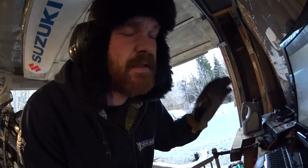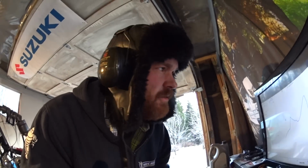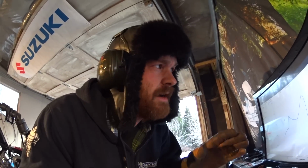12.9 horsepower. It's down from before, but the fuel has been sitting here in the tank for many weeks now, and the temperature is different, so this could just be irregularities. I will try advancing the timing a little bit and we'll see what happens.